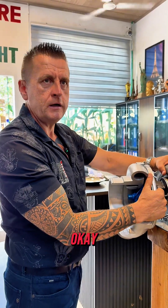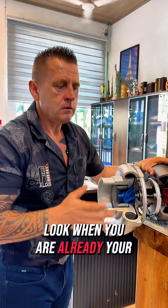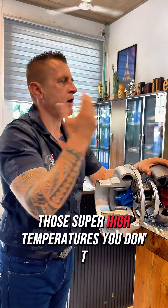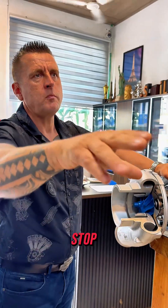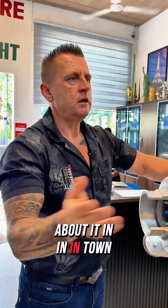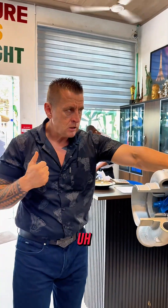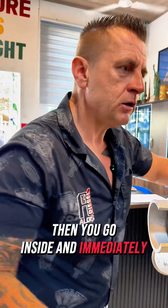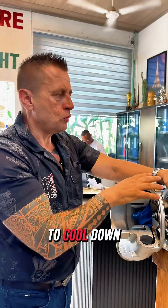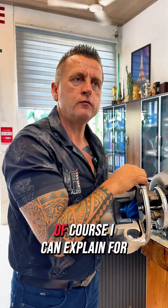Any questions? — Yes, if I'm stuck in traffic for some time, do I still have to idle the engine for a minute before switching off? Good question. When your engine is already idling, there are no super-high temperatures. If you're in town traffic going very slowly and then you stop, you don't need to wait — just switch off and forget about it. But after highway driving, if police stop you or you go for fuel and immediately switch off, don't do that. Give 30 seconds for the turbo to cool down and oil will keep circulating without boiling inside.